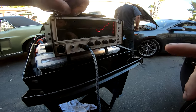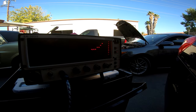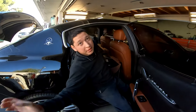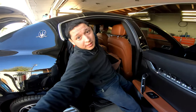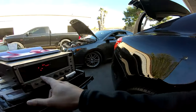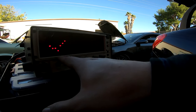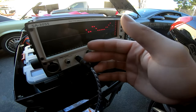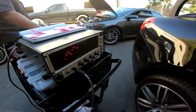So that's what we're going to repair — we're going to repair 19kHz and the 300Hz rolloff. Now replaying the front signals, it's a little flatter, so that's nicer. We got a better signal coming from the front. We have a little bit of actual bass playing here and it doesn't roll off at 300 — it actually starts rolling off at 125Hz, so we have a little more bass coming out of the front speakers.